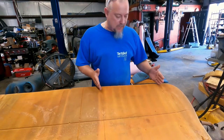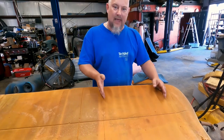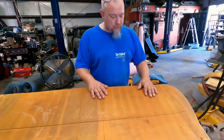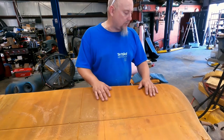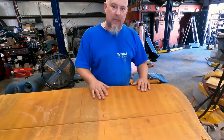What we're going to be doing to this seat is cutting right here where I have these two lines marked out. We're going to be dropping it down an inch. Typically, I have a foam saw or a hacksaw blade that I use. I'm going to cut it and try to have it as smooth as possible, but any unfinished edges will actually clean up with a nice side grinder. Then we'll move to the next step where we're going to add foam and start doing angles.